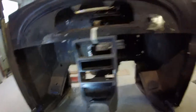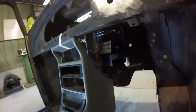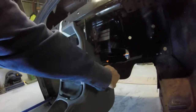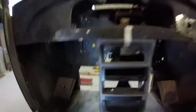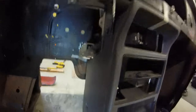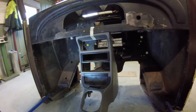This insert is just hitting up against the heater box, but the heater box isn't bolted in yet — I could probably gain like even one or two mil which'll be perfect. By the time I pull the dash out to where it's got to be, that console is going to fit nice. It just needs a little bit of tweaking. I've reached my objective — the aircon looks as if it's all going to fit, the console's going to fit, the CD player should go in there, and I should be able to get my heater controls in there. If not, I can build a little spacer block and bring the controls forward, and they'd still look really neat.